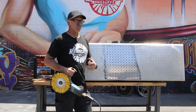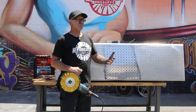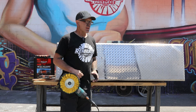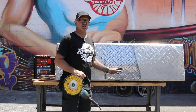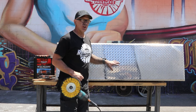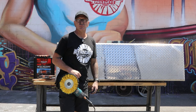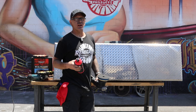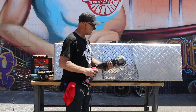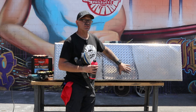So I've got two cuts done. Now here's where some guys will switch out to say a G16 or a lighter green compound to color it up — not me. I'm actually going to take an orbital polisher and a foam pad with the Pro Red and orbital polish this whole area to clean up around all these diamonds; it's going to leave a nice finish. I'm going to put the Pro Red on the foam pad and orbital polish this whole section right here — this allows for agitation on all sides of the diamonds.